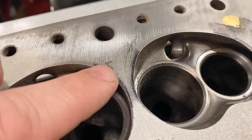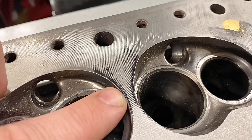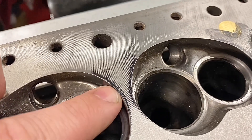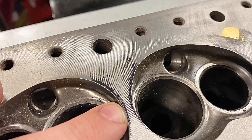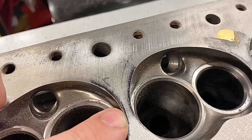This demonstrates one of the reasons why when you build an engine, you should really have the head machined flat. If you look at this black pen — now this was put on to enable me to scribe gasket lines so I could see them — it obviously aids as a visual aid to see what the contact points are when the machine cutting tool is going past. In this case, you can see the effective machined area is quite narrow. So if you hadn't machined that cylinder head, the gasket there wouldn't have actually been clamped to its full potential because the contact patch is narrower and it wouldn't have been flat, so it wouldn't have been given a proper seal all the way across.